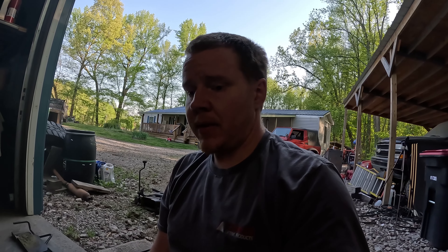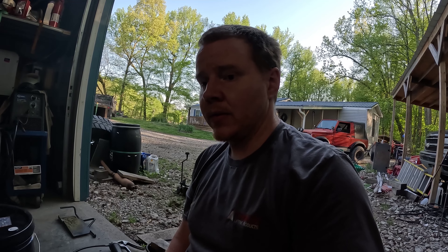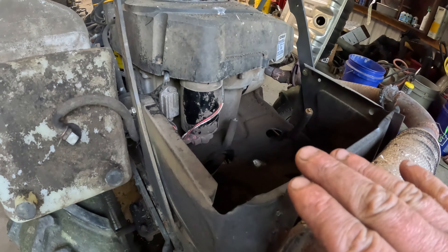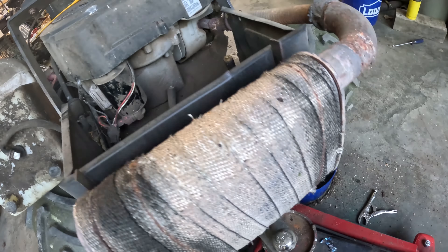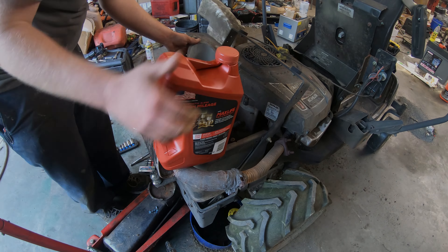The deck is ready to go, so we'll come back in here. The oil has quit draining, so go on and put the plug back in the hose, fill the oil up, and then we'll go on and drain the drives. If you remember from one of my first videos on this mower, we modified the drives so they are now serviceable — I've got pipe plugs in the bottoms of the cases. The transaxles are still warm, so I'm going to pull those plugs and let them drain. We'll have to pull the fuel tank, at least move it up and out of the way, to get to the fill plugs.